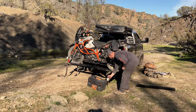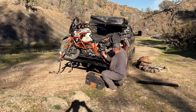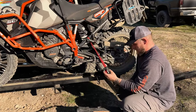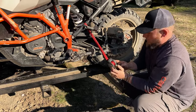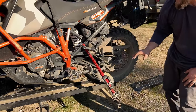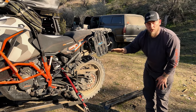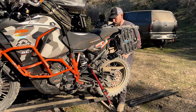I hook two straps to the back of the bike, going up through the subframe — inside that passenger foot peg — then come back down to the ring on the stand. I run straps to the subframe because if you mount to the tire or something like that, the suspension can still compress in the back and the bike bounces around a lot. Strapping to the subframe compresses the suspension a little bit and it's a lot more stable.